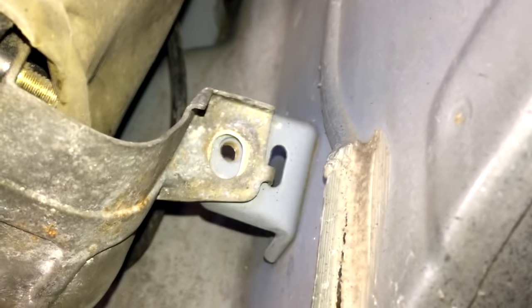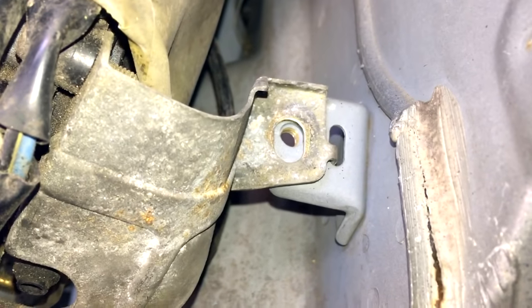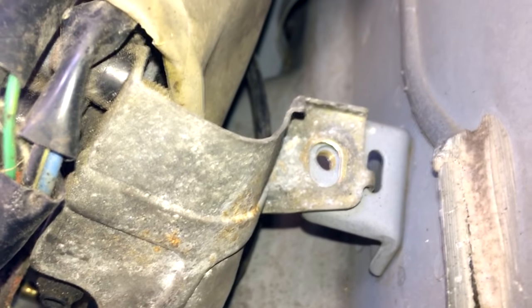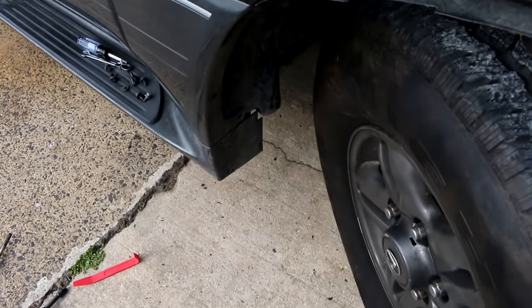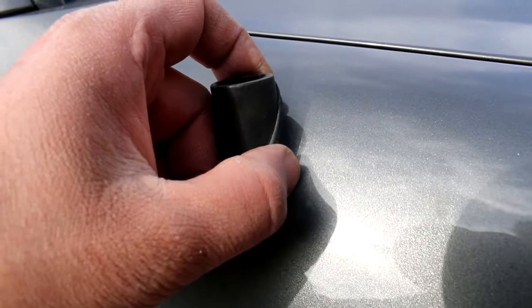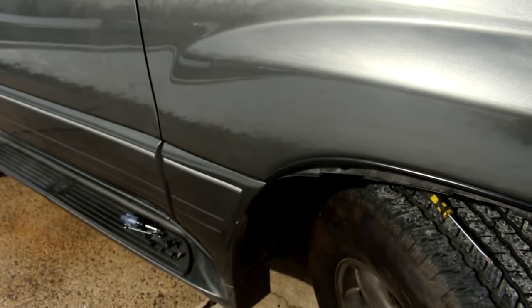You can see that's the screw you need to put back in — that's the only thing holding this whole assembly on. There's a little hook on there that hooks onto the side that'll hold it in place while you screw it back on. That's the only screw, and that's it. So that one bolt is literally the only thing holding it on. Then up here you just keep wiggling it and this will come loose. Then you pry that off and it slides right out.